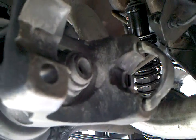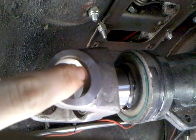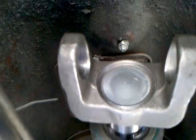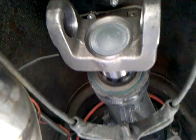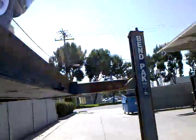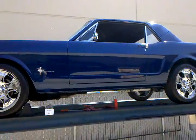After that joint is identified in the back, the 1310 does match up with this yoke right here. It has the outside snap ring grooves in it, and cap diameter is once again inch and a sixteenth for this one. So after both U-joints are identified and the measurements supplied centerline to centerline, you're good to go. That's how to measure a one-piece driveshaft at PowerChain.